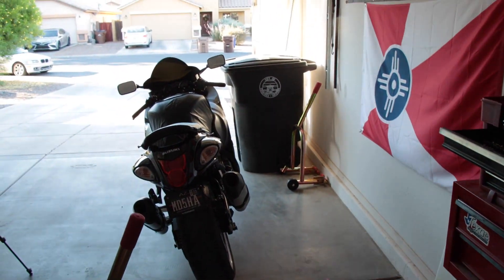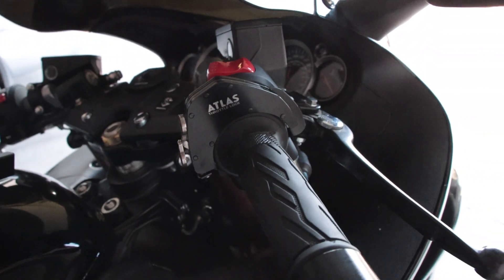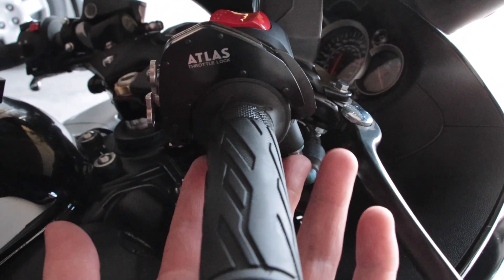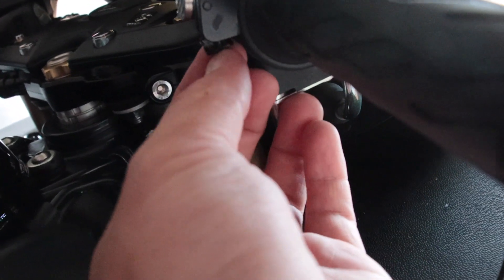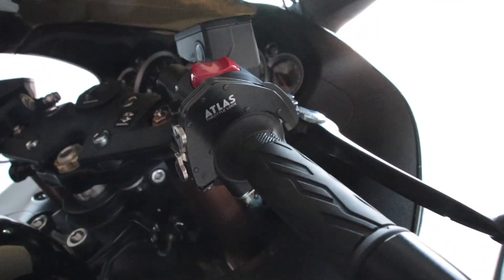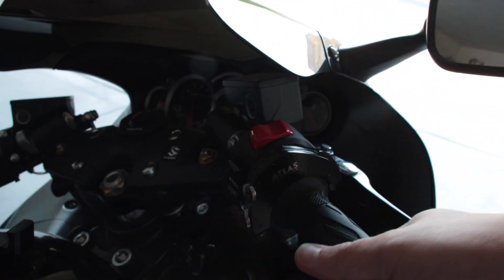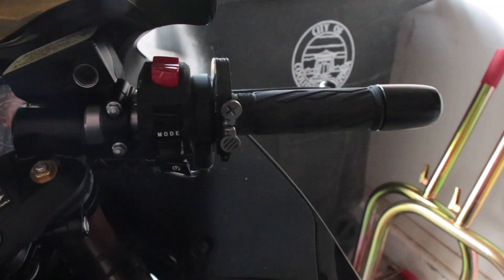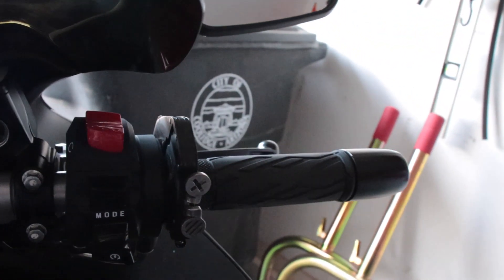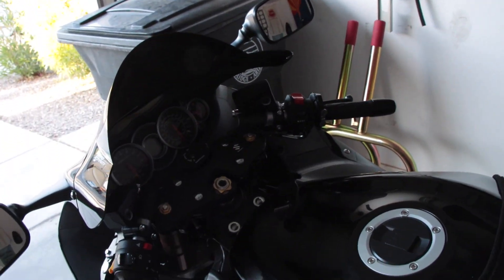Quick little update: when I put the throttle lock back on — it's not that difficult, Atlas actually makes a video showing what's going on — it's a two-piece part. Underneath there's a little clamp and it grabs some teeth inside, then a little screw goes on. You don't want it super tight or the throttle won't work; just tight enough to grab. I super glued a new pad onto it and had to realign it due to the clearance issue. Looks like it'll work out, so I'm gonna take it out for a ride shortly. Thanks for watching — see you on the next project.